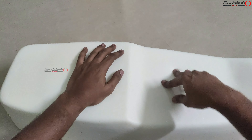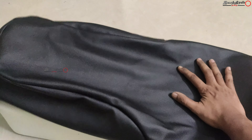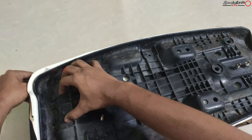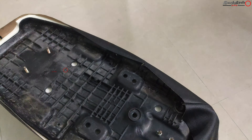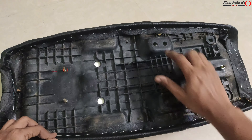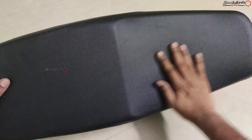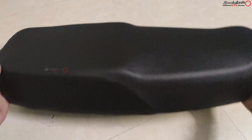After painting the entire bracket assemblies, I checked whether the seating was correct. Then I started installing the seat cover — this is a stitched one and you can get it on Amazon. If the link is available I will mention it in the description. When sizing, what you have to do is staple two opposite corners first, then staple all around, and finally stretch and staple the front and left part. I'm using a Kangaroo brand stapler.